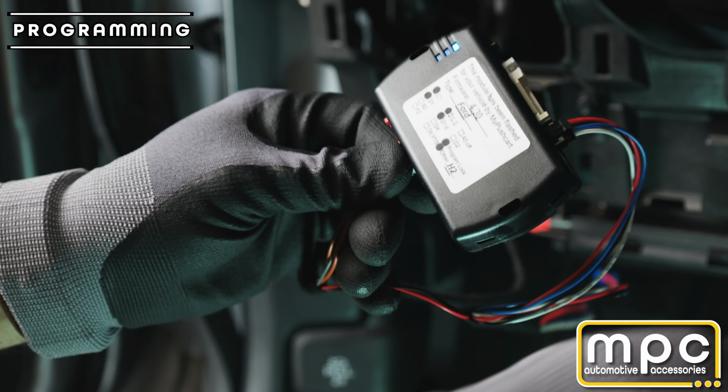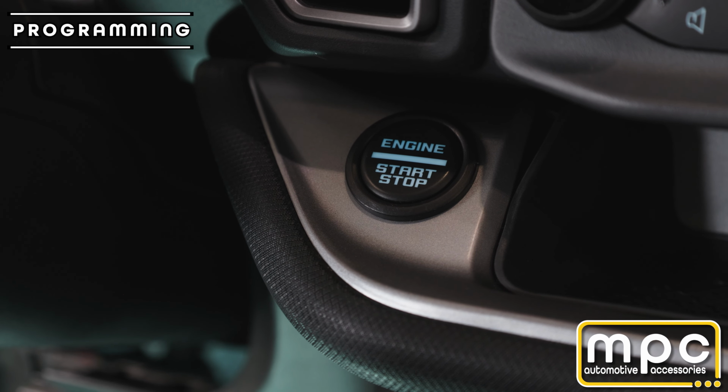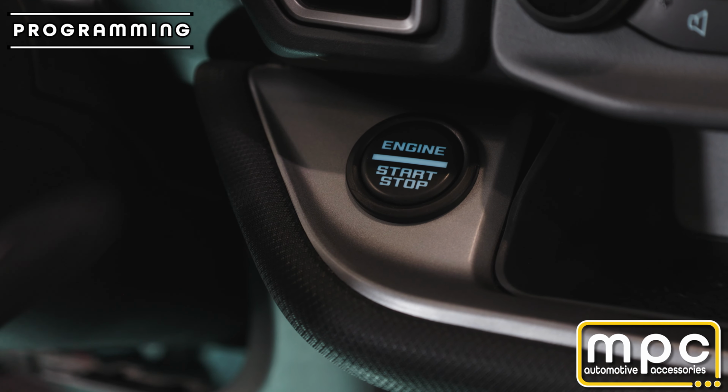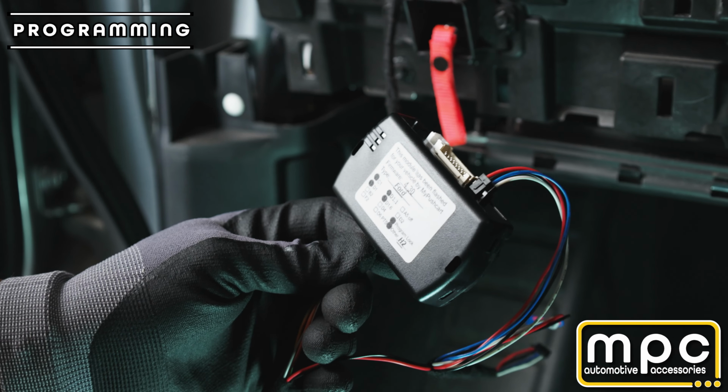There we go. And we're going to turn the ignition key to the on position and wait for the blue light to come back on flashing. There we go. Now that it's flashing, turn the ignition to the off position. The blue light will turn off. The module is now programmed and we're ready to start the vehicle.